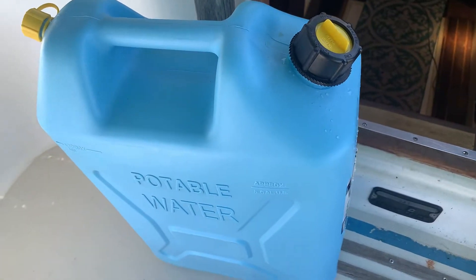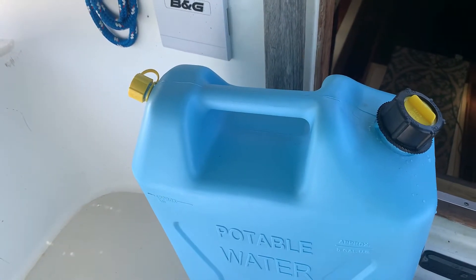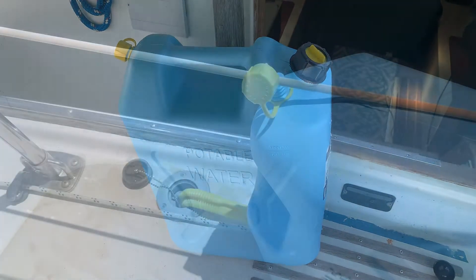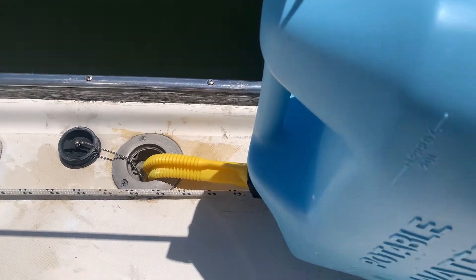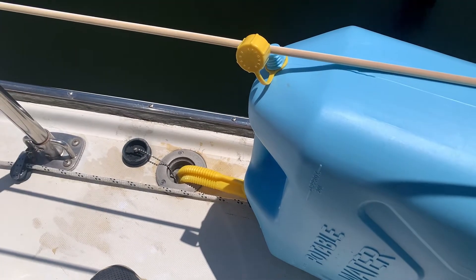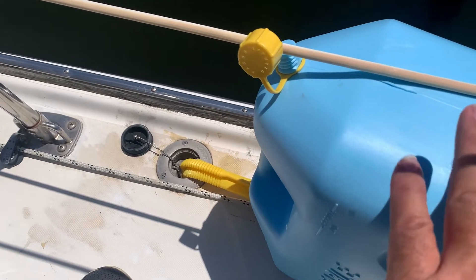We have our bleach — we put seven tablespoons in this jug, which is what it calls for the entire 26 and a half gallons of water. I'm going to drop this in the tank, give it a stir, and open the faucets to get our bleach water running through the entire system. That's the beauty of that flexible spigot — you can just lay the tank flat on its side, open the air vent, and it'll get all the contents into the water tank. So now this is the water with the bleach for the system — this last 10 gallons should fill up our entire tank and we should be ready to get our system sanitized.